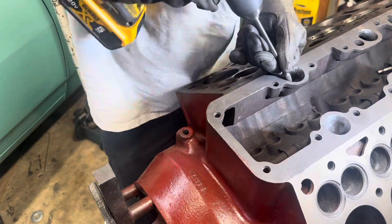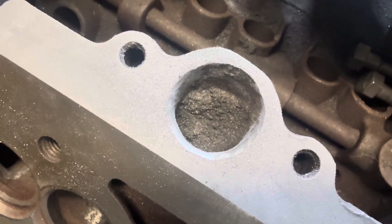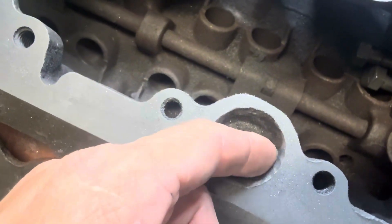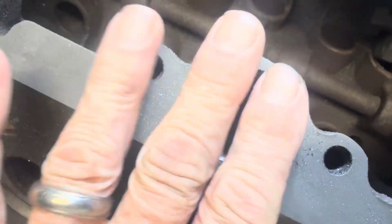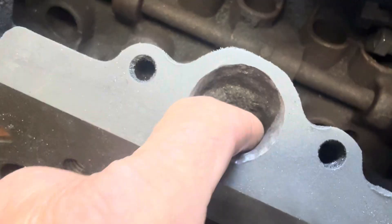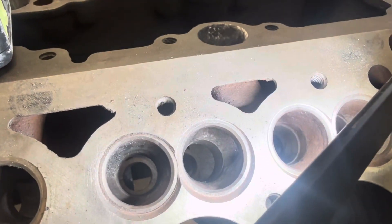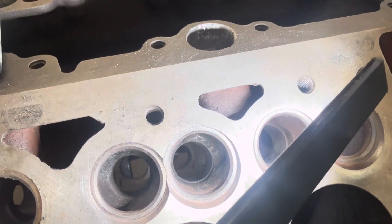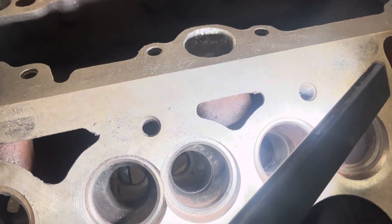A little fun fact: what I like to do is just get it close and then I can work on tapering or getting this whole choking thing out of here, open this up after. Once you establish the outer hole, you can kind of blend in, bearing in mind not to cut into the passages. I think it's pretty thin on this, so again I'm not going crazy - I'm not going to be making 500 horsepower with this thing. I just want it a little better than stock, but if you cut into the water jacket, you've got big problems.